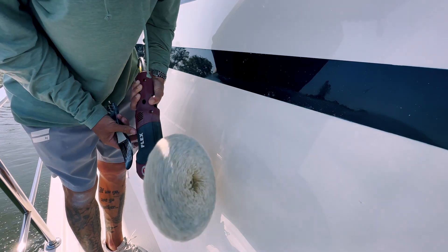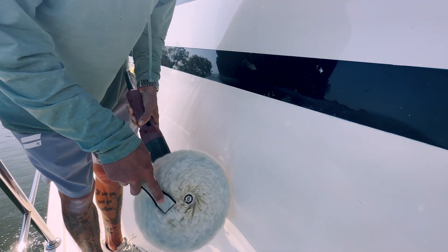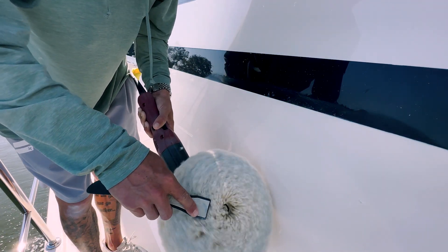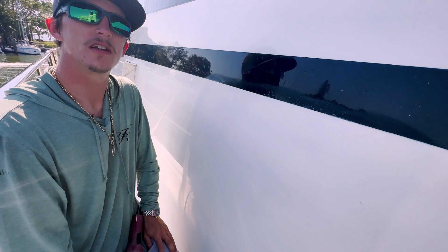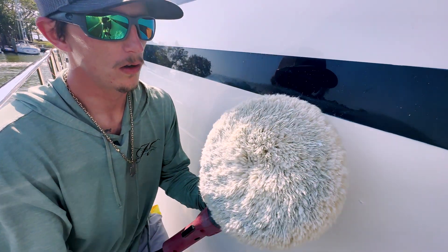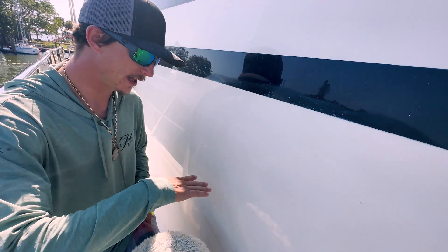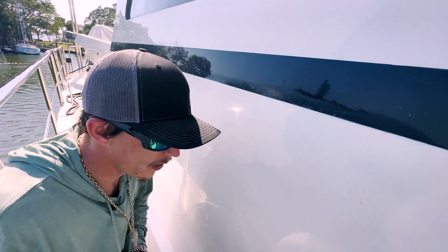Cleaning your pad is essential. They get a little wet and it makes it more difficult to clean. The Rupes brush gets it out really nice. I do a fast pass on three and then come down to one and refluff it — picks those fibers back up so you're getting a nice smooth surface. Every section, because you don't want it caking up in there. Already this pad has done two sections and those gnarly matted fibers will end up actually causing scratches. I cleaned it out and I'm just going to hit this area one more time real lightly — the product's pretty dried, so it's more of a polishing step than anything.